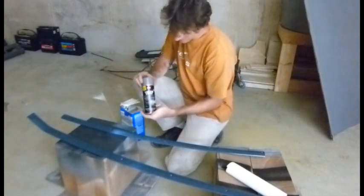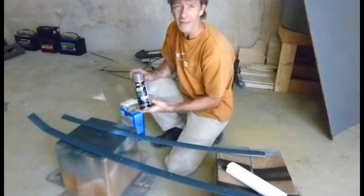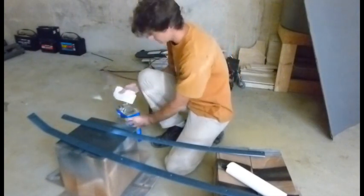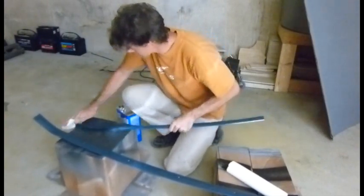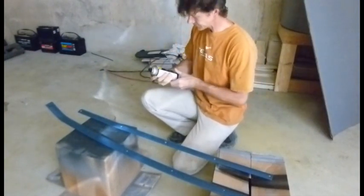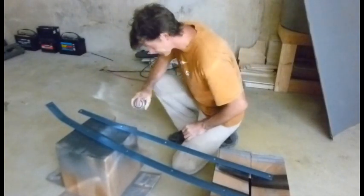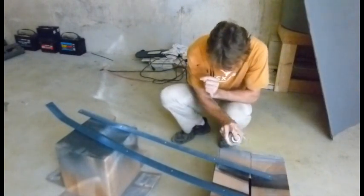And for the dye, we're using SEM color code. This is a medium gray, which is a little lighter than the factory gray in the Suburban, but it looks really nice. All right, and your first coat should be light. It's got a new nozzle for improved atomization, coverage, and pattern. Nice. So just a light coat to start with the adhesion.